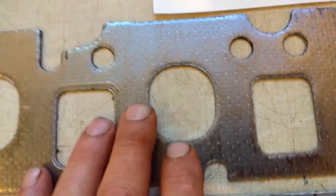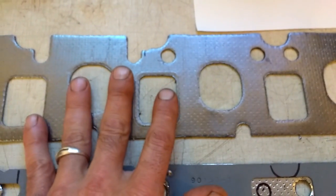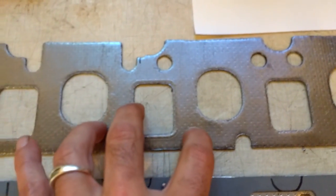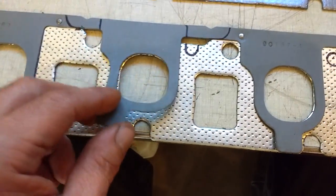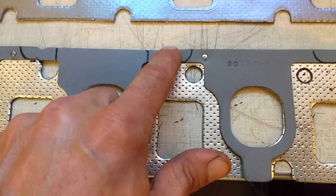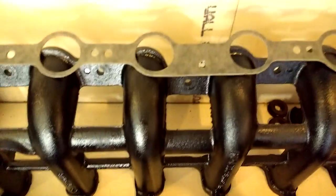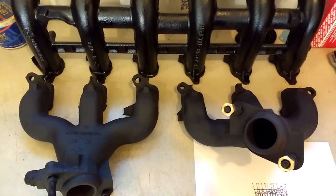This gasket is a very common MS gasket, and the part number on that one is 93837. I would consider that one exhaust only — do not use only this gasket when you put the intake and exhaust manifolds on; this is just for the exhaust. I would use the 95647, which is one of these thinner gaskets built for EFI — basically to go around the smog tubes — and it also contains the upper plenum gasket as well. So if you're going to use one of these kits, make sure you use this one. I hope this helped you guys have a successful manifold swap with no leaks. Good luck.